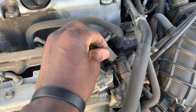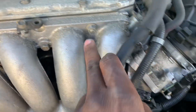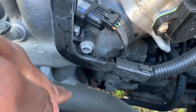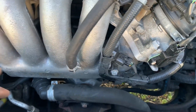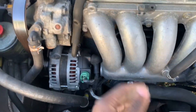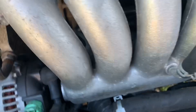Next step is taking out these five fasteners — there's a nut, a bolt, a nut, a bolt, a nut, and another bolt in the back. I'm going to take those five out. Also, if you look down, there's a bolt right here for that bracket, so we're going to take that out too. The reason is I need to separate this piece from the rest of the intake.